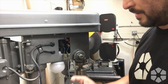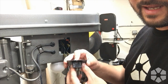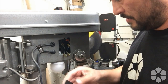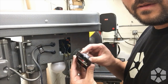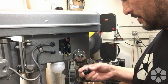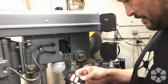I guess I'm only gonna replace the bottom one because it's the one that's broken — I mostly just need this thing to work right now. It's going to be kind of a hassle to get back out, but there are these little spring-loaded wings on here and you basically just have to compress those. This switch was nice because the lamp is actually wired internally — you don't need a separate power leg to run it. Oh, it dropped on the floor. I also don't know which way is on. I'm going to guess this way because the little lamp is over here, so I'm assuming when you push that side it's illuminated.